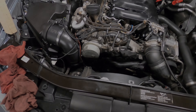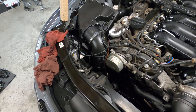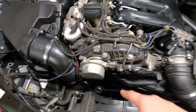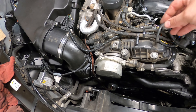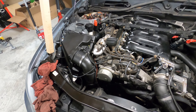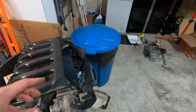Now that we've got our EGR cooler completely deleted, block-off plate in place, two coolant caps in place, I also capped off the tee in the vacuum line for the opening flap. This EGR valve connector — you can either tie it off to the wiring harness or just let it hang down; it won't hit anything since the drive belt runs quite a bit lower than that.